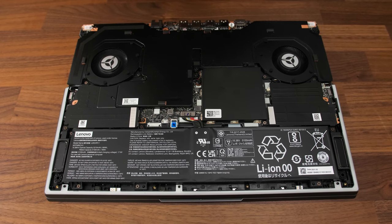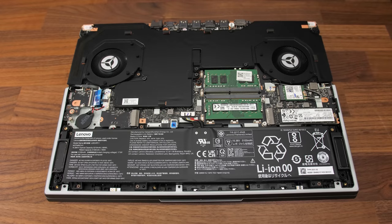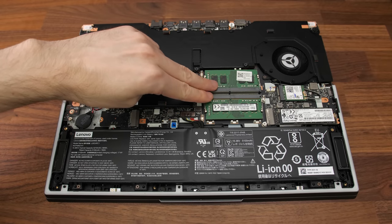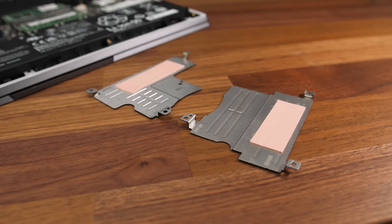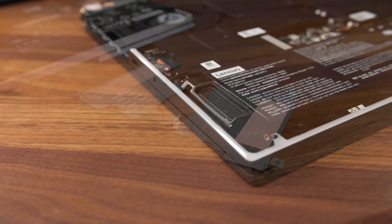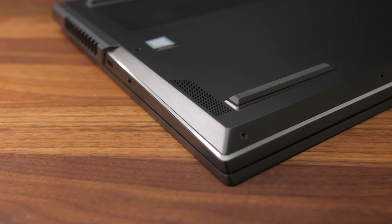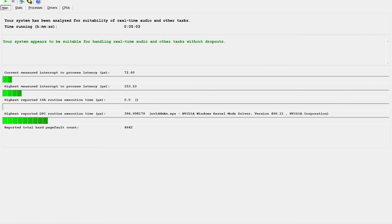Inside, the storage, Wi-Fi and memory are covered by metal plates. The ones on the sides have 3 Phillips head screws while the memory one just pries off. There's a battery down the front, two M.2 storage slots above on both left and right, two memory slots in the center, and a Wi-Fi 6 card to the right of that. Both metal plates over the M.2 slots have thermal pads. The speakers are underneath down the front on the left and right sides, they sound above average for a gaming laptop with some bass and remain clear at full volume. The latencymon results were looking decent as well.